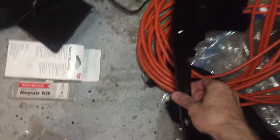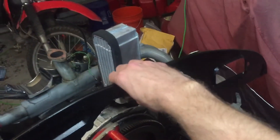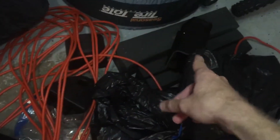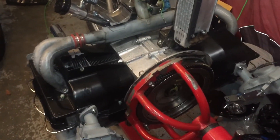From there you can put on the skirt pieces. This one is the back, which sits just like this — this is for a doghouse piece. You can put your front piece on, though you don't need that to have the engine in. And then finally your doghouse metal pieces, which are a little more complicated — they fit over here attached to your fan shroud. And that's the order you want to go in.